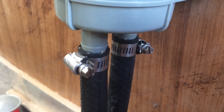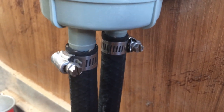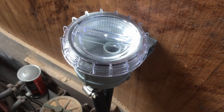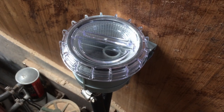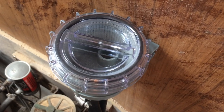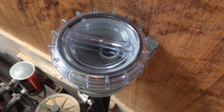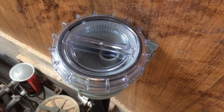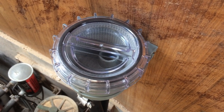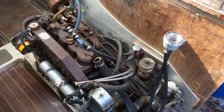I've attached the outlet hose as well and I'm going to splice this hose back into the hose that leads into the raw water intake pump. I've got everything hooked back up and double-checked to make sure all the hoses are connected properly and in the right order, and the cap is back on the strainer. One thing I recommend everyone keep aboard their boat is a lot of extra hose, hose fittings, and hose clamps — it's always good to have those spares available. Let's fire this engine back up and see if this strainer is going to work out.